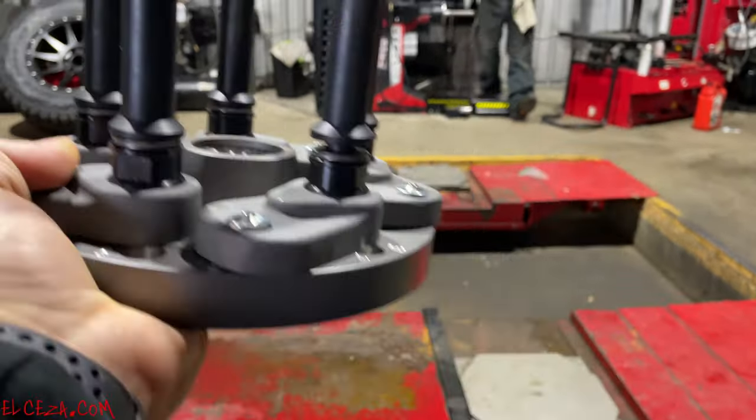If you get that, check the balancer and make sure it's steady. So before you call me and tell me it's chasing weights, let's make sure we don't have a bunch of debris on it. That's my whole point. Don't beat on it, clean it up. Fair enough? Any questions? Everybody knows how to put weights on, so I'm not going to put the weights on. Do y'all want to do this tire and see how the straight side works?